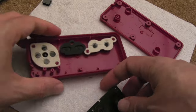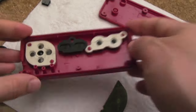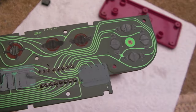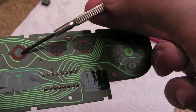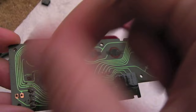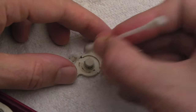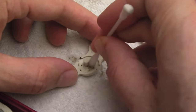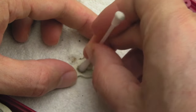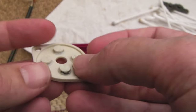The player one controller is held together with six screws — it's a bit dirtier and needs a good cleanup. The PCB is slightly different: instead of copper contacts, it's got carbon-type pads stuck on top, so I have to be careful not to wipe too hard with IPA. The silicon bits on the buttons are pretty disgusting.